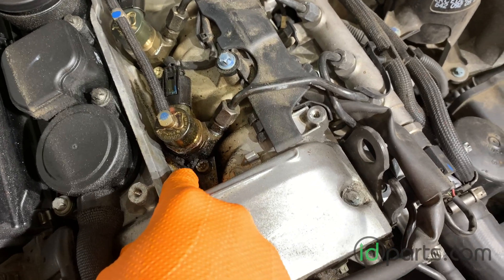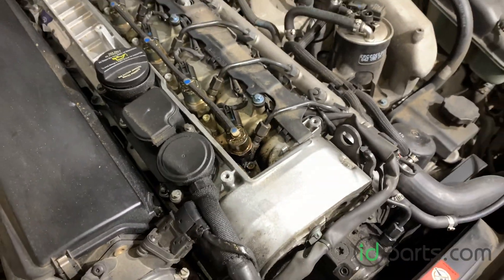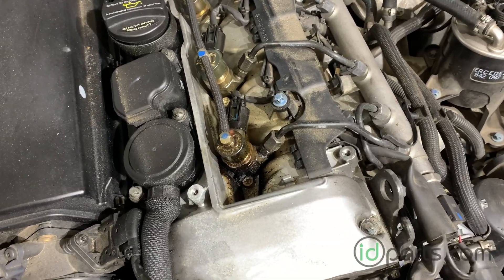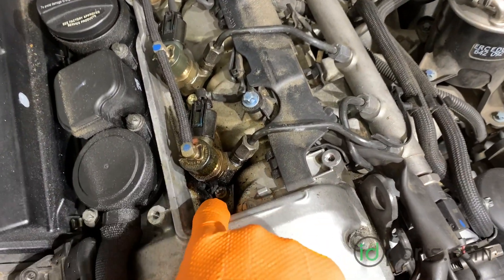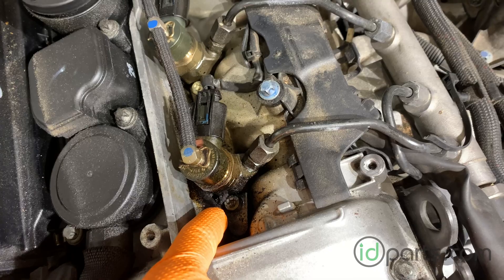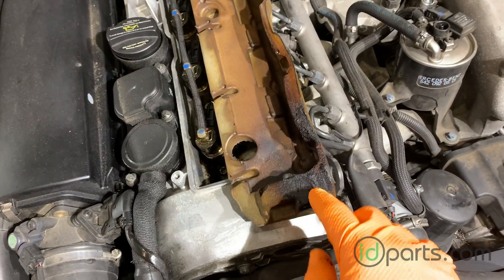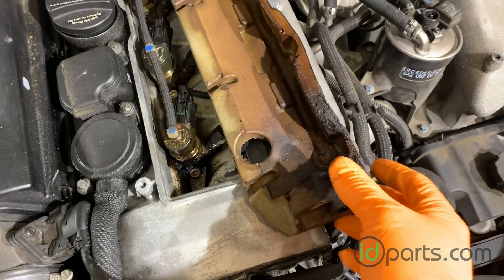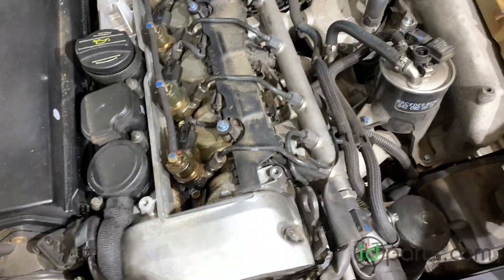This buildup is a mixture of carbon from exhaust gases as well as unburnt fuel. A very common symptom of black death is that you'll smell diesel fuel around the engine. You'll check all the lines and there won't be any visible leaks, but if you take off the cover you'll see this black mess. You can also tell by looking at the underside of the sound paneling — you'll see a burnt area from hot exhaust gases and unburnt fuel coming out and toasting the vibration and noise cover.